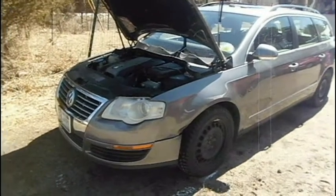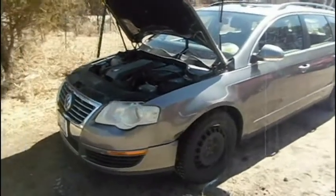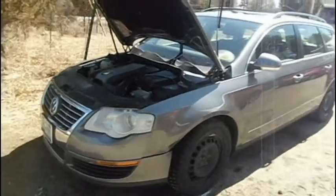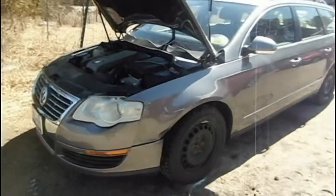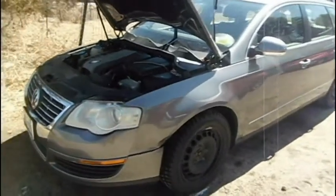When I got the car it was in pretty bad shape, so there was a lot of metal in the oil. I had to buy a new oil filter canister because the center spindle was gone — the filter was free floating in there because there was no bottom mount.